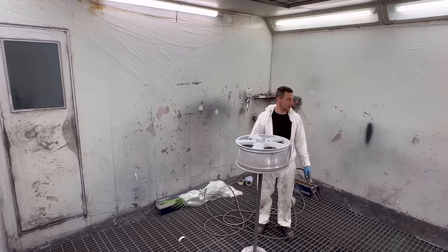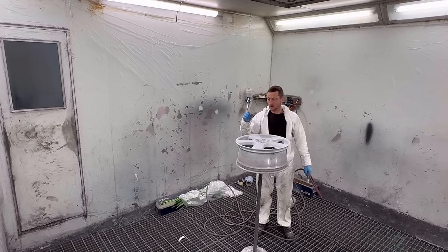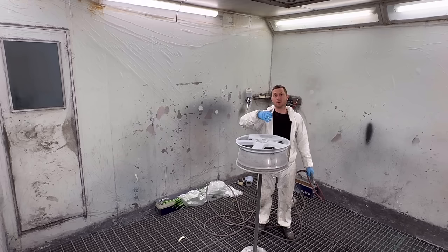I'm not going to rub this primer down — it's wet on wet. The primer is just about flashing off. If I stuck my finger in it, it would leave an imprint, but it has flashed off. That type of painting is called wet on wet: wet primer, let it flash off, straight over with the paint.